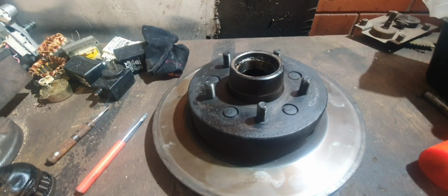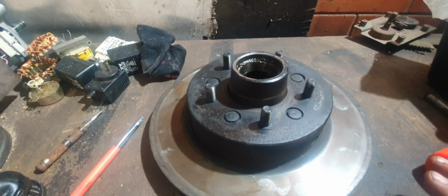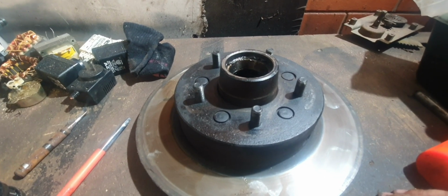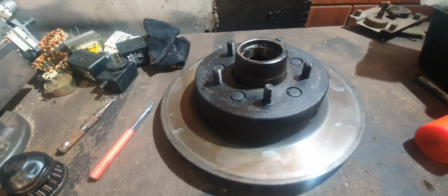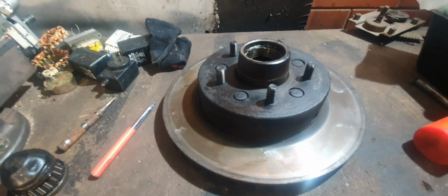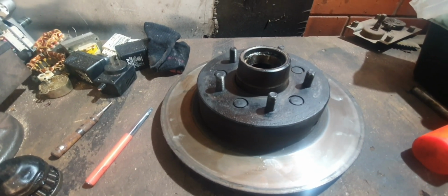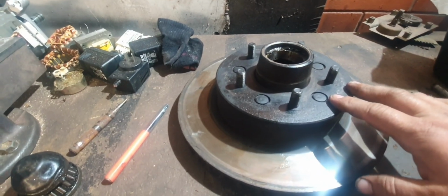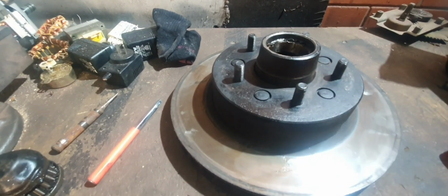So this video is a bit of a continuation of a day in the life of the mechanic short. We were doing brakes on a big block C3 Corvette. Now, one of the issues I come across, and I haven't come across this before, but I guess there'd be quite a few of you that have worked on Chevy muscle cars and the likes. Chevy in their wisdom decided to rivet the rotors to the hubs.